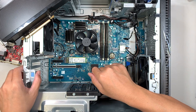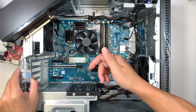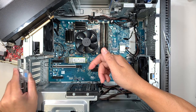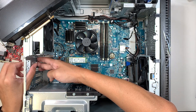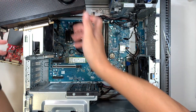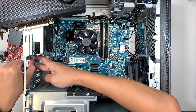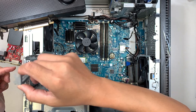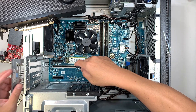Let's assume that you have done all the research. What you want to do next is go ahead and lift up the side here — this is just a latch that closes it in. To open, you just lift it up. Now here I need two slots because my graphics card requires two slots. All you have to do is slide this bracket straight up and remove it. Now I have the two slots ready to be installed.